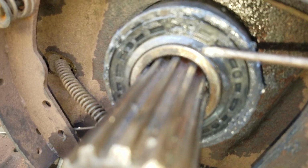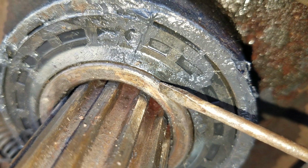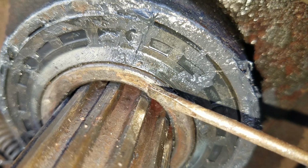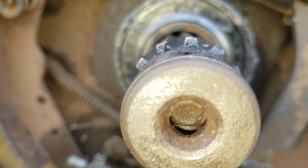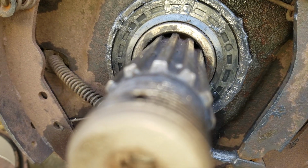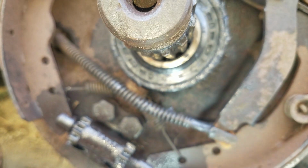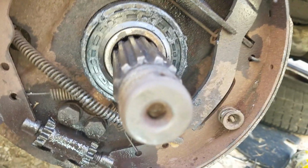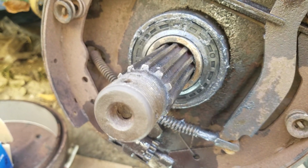And this top edge here, this top edge is more curved than this top edge on the other side of this. The inboard top edge is sharper. Look at the tops of the stub axle. See how nice and sharp they are? That's why you need extra stub axles. They strip and you're screwed. The wheel won't slide on. Well, the wheel will slide on, but it won't turn.